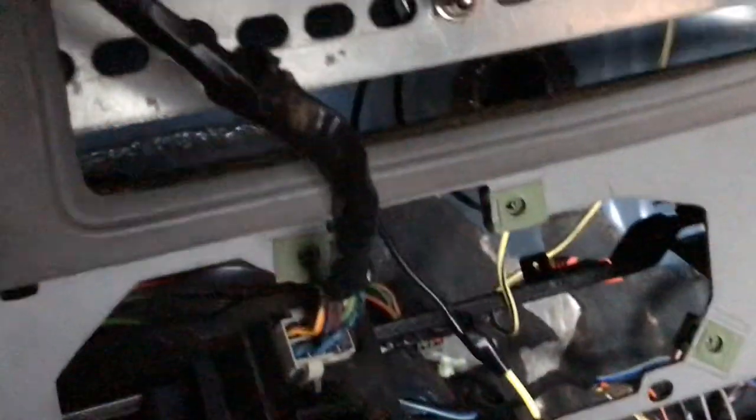And I'm going to fire it up and adjust the timing on this and show you what it's like. Got new plugs in it. I got kind of a little hotter plug in it. New wires, 9mm wires, everything I can do to it. There's my electric fans. There's my ECU that's been rebuilt. It's an A9L. Wires look a mess there, but everything's ready to go. I'm ready to put it back together.